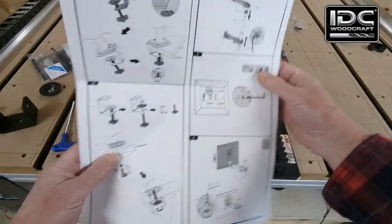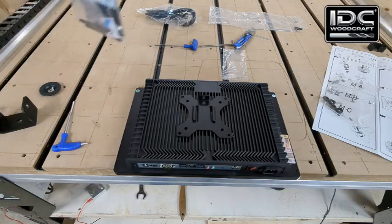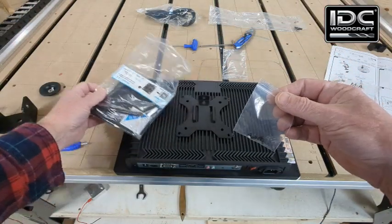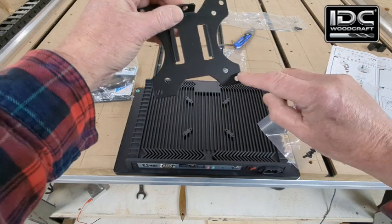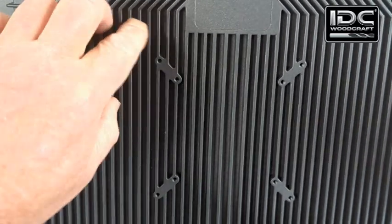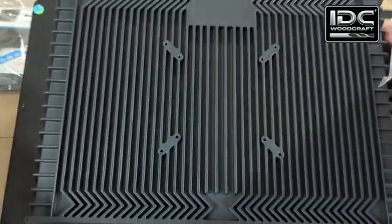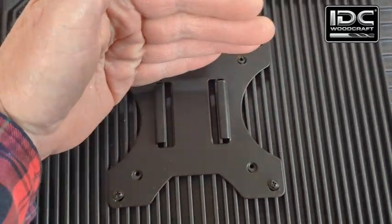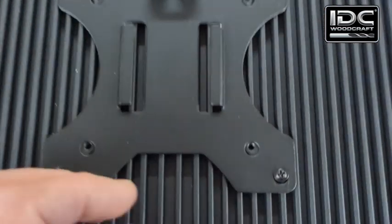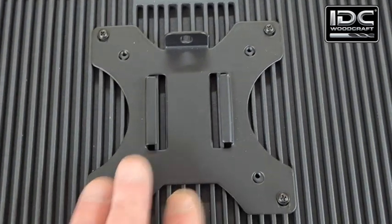The screws holding the panel bracket on are not the MA, MB, or MC screws mentioned in the instructions. Instead, use the little black screws in the separate packet that comes with the kit. Put them on the four outside corner holes on the back of the panel. The panel has two sets of holes on each side matching the bracket holes, but use the outside screw holes. Pull the plate toward the bottom since the panel weight will rest on it and it would tend to slide down. Use the washers — any smaller and they'd fit through the holes — and make them nice and snug.